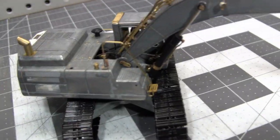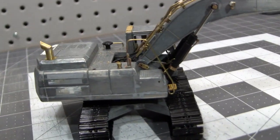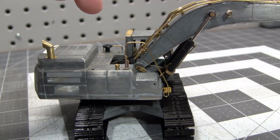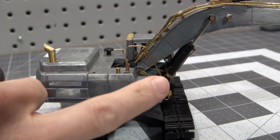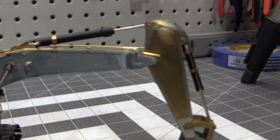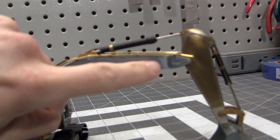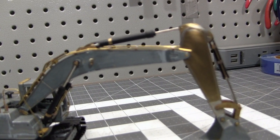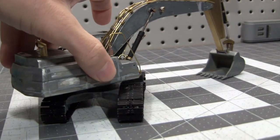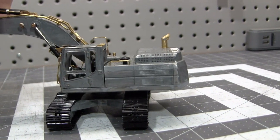In a few seconds here, I'll take this thing back apart, and then we're gonna start doing the final stages of bodywork. So, all this filling in right here that we did, I'm gonna take and mask the whole top off. And then start applying the first stage of primer to everywhere that there was any form of body work done, like the spot right here. The camera will focus on it, not the background. Well, trust me, there's a spot there we need to work on. And then just cleaning up all these lines throughout here. Cleaning up anything on the back that needs to be done. Likewise on this side as well.